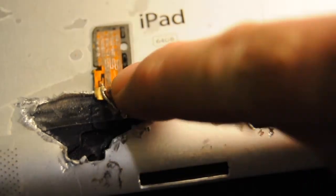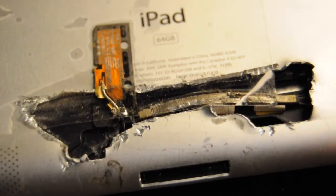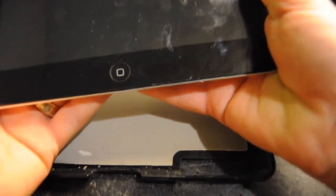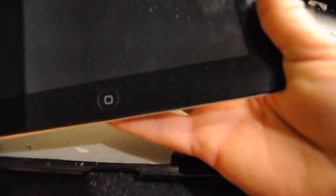One simple thing you can do is bring it onto the outside of the aluminum. The Wi-Fi signal is not going to go through the aluminum — the Wi-Fi goes through the glass. So when it's flipped over this way, the signal radiates up through the glass, but it doesn't radiate through to your hands. Your hands are back here, and the Wi-Fi is coming out the front of the unit, so technically your hands wouldn't be covering the Wi-Fi in that case. All the Wi-Fi would be radiating out of the bottom basically at your face.